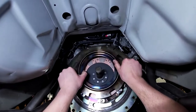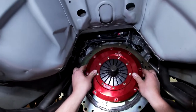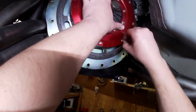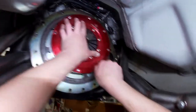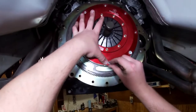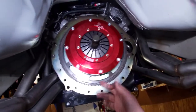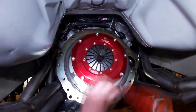I just cleaned this off. We'll set this in here. I'm going to have to sit this on here and try to not push all the bolts in. Again, make sure the cone is facing in on these washers. We'll start the nuts on — oh, it's magnetic? That's pretty trick. You fight with this for a little bit and eventually you get it to work. You've got everything started in — kind of just put your finger underneath in the back and squeeze it together. I believe these are 25 foot-pounds but we're going to run these down with the impact.